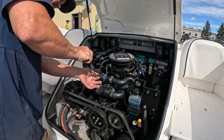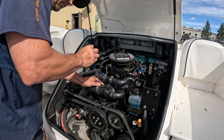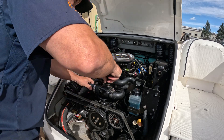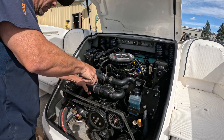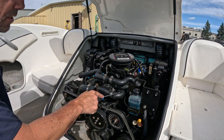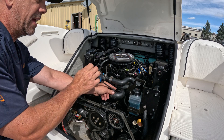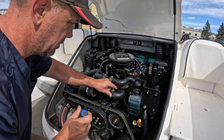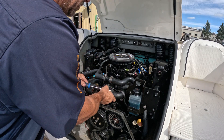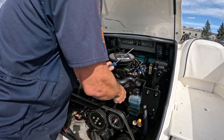Go ahead and spin this one off. This is where we're going to fill the engine with antifreeze — we're not even going to run the engine while it's here. This hose is the water supply hose that comes up from the leg. Your water pump pumps the water into this hose, then it comes up to this thermostat housing. I run the screwdriver around just to break the seal and lift, and it pops off.